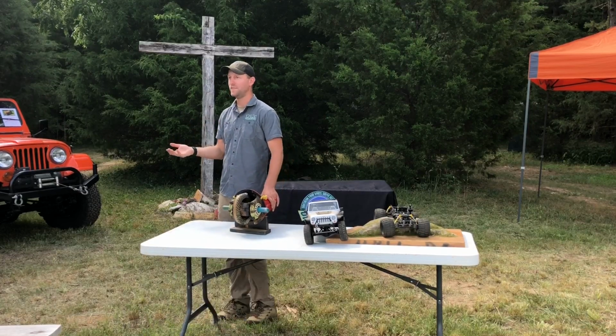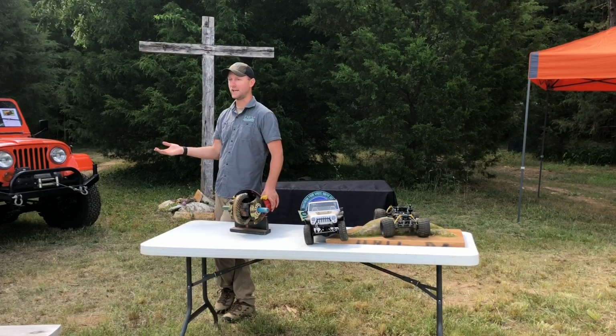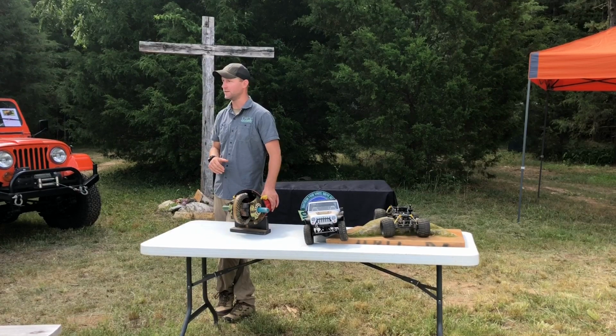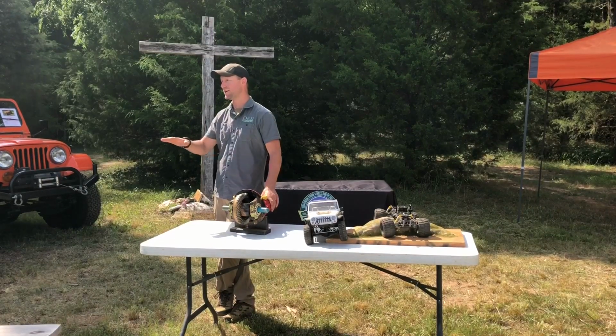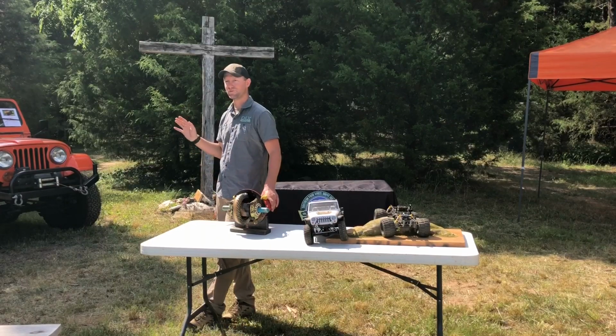Jeep, on the TJ, you had to replace a fuse. On the JK, when it goes into 4-wheel drive low range, you can start it right in gear. So you just turn the key and that starter motor will start turning those tires and cranking that motor until the motor takes over, and it's moving right along. One of the greatest tools off-road.